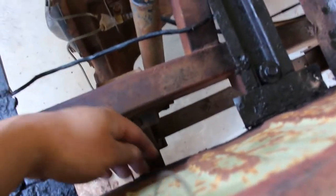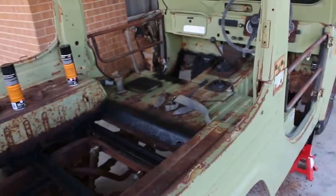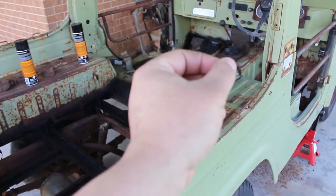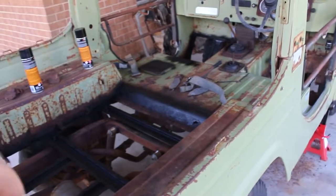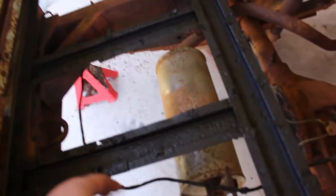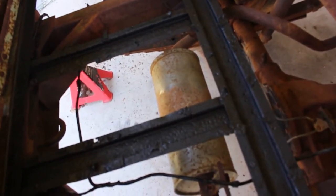To mount the floor sheet, the floor had a 90-degree fold on it and was spot welded through the side as well. I've got a tool I fabbed up a while ago to fold a return on my brother's K25 Deluxe Corolla mini tub — it's basically round bar with a slot in it, you slide it up the sheet and tease it along to 90 degrees. So I'll do that in the bottom of the wheel tubs, creating a ledge to spot weld the sheet down to. These braces actually came up pretty good once I hit them with a wire brush — they're a lot thicker than I thought, I might get away with not having to replace them.